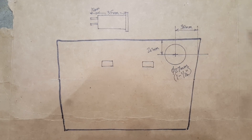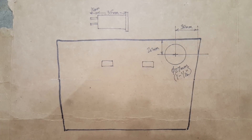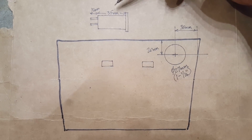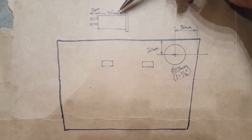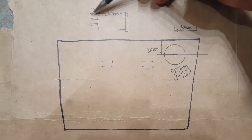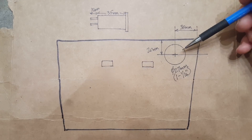There is also a wire that runs across the back of this panel. It's not directly up against the panel, but you just need to be careful you don't hit it when drilling the hole. Here's a cross-section of the power port I used — it's about 35mm deep. The terminals extend another 10mm, and there was room for this behind the panel once you drill the hole.